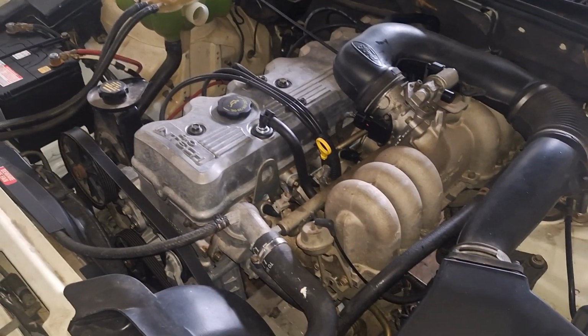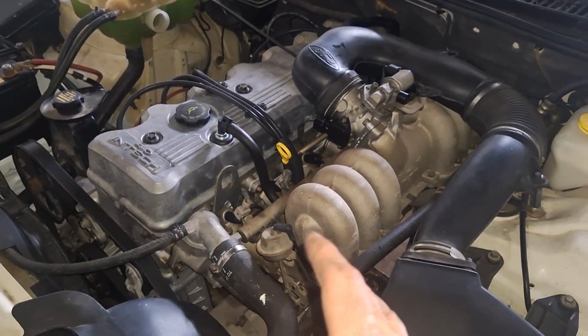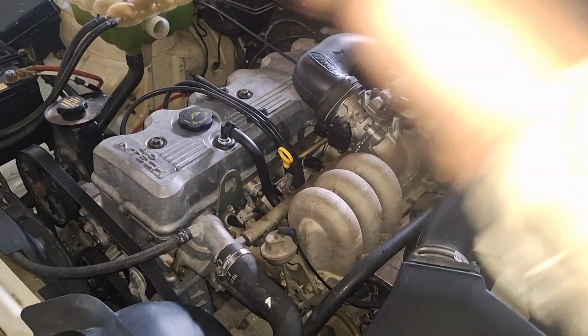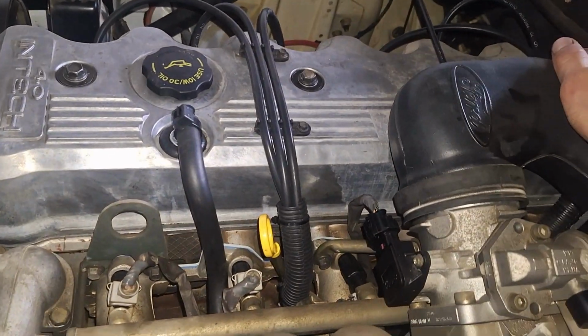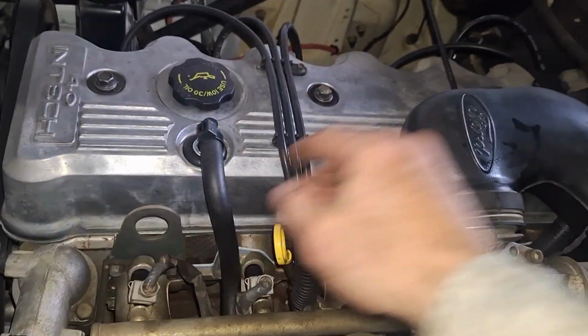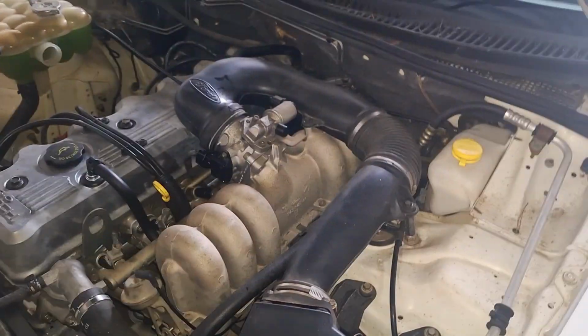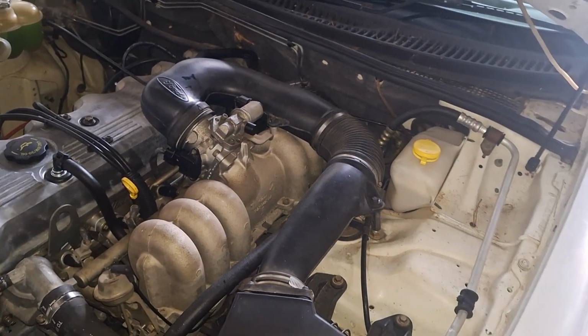So well worth the money, because they can backfire, they can fall apart, and you can be chasing a problem and all of a sudden it's just the PCV valve. It will actually draw through here and there, like through a loop through the engine, to pull all the fumes out. So be careful of that. It's one of those things that's often overlooked.